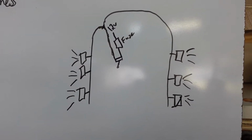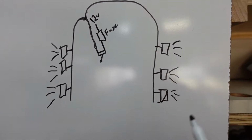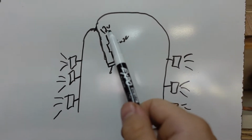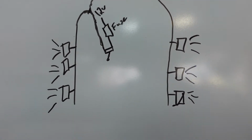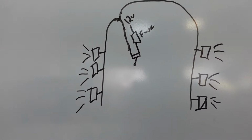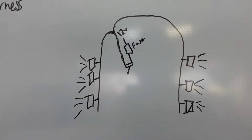And I'm gonna show y'all up top how I have them hooked up to the switch. All right, so this is how you wire up the lights. As you can see, here are the lights on both sides of the truck. You need to connect both sides of the truck together. Once you do, you run that wire to a switch, and then from the switch, you go to a fuse, and then from the fuse, you go to the battery. I have a fuse box in my center console, right where all my switches are, so it makes it really easy. So I just hook up the switch to the fuse box, and the fuse box goes to the battery. It's a really easy way of doing it. And honestly, these lights are super easy to install. Anyone can do them. Like, everyone should have these things.